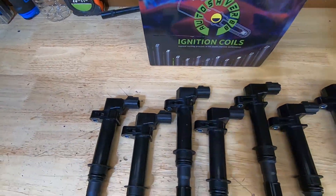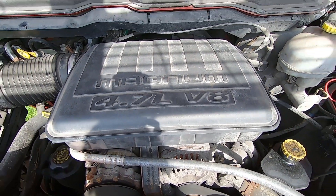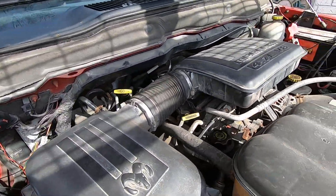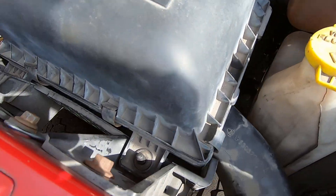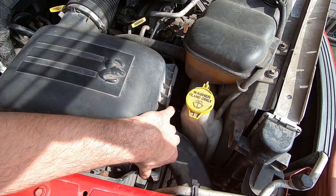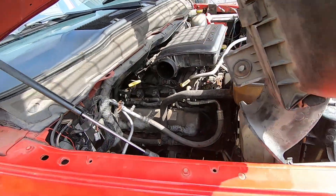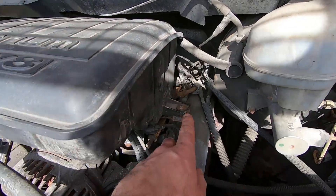So what we'll do is go ahead and I'll show you guys how to install these. We're going to install this on my 4.7 liter V8 — this is an 03 Dodge Ram. First thing I did is went ahead and disconnected the battery cables. Then we're going to go ahead and remove the air filter. I already loosened this band here — just pop that off. You guys can see down here there's just a couple nubs; this whole air filter I'll go ahead and lift out.